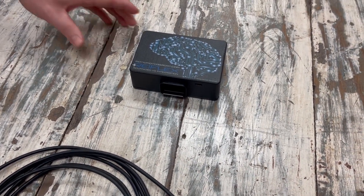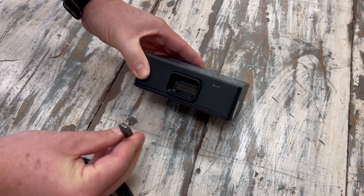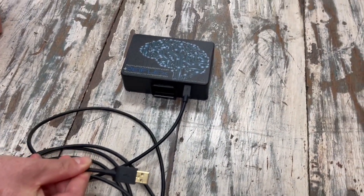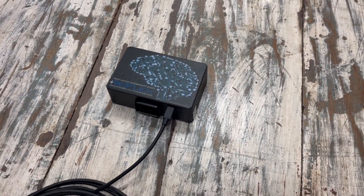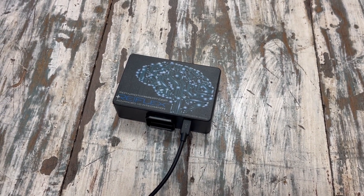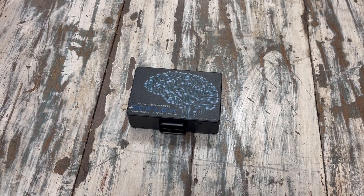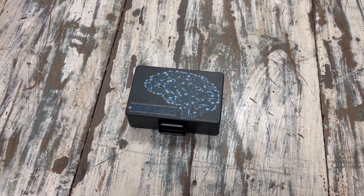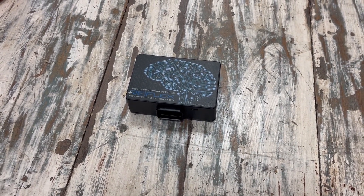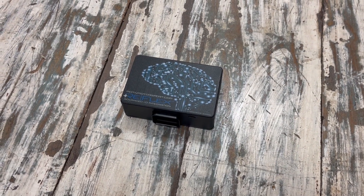The USB port plugs right into the side of the box. Here on the bench you can see it's a standard micro USB — we just plug it right into the box, giving us our connection with a standard USB on the other side ready to plug into the laptop. At this point that finishes our installation of the Motive controller box. We generally don't leave the USB connected — that's something we just use when we're going to write to the box. Once your initial setup and basic calibration is done, you're pretty much set and forget. You normally don't need to connect to it again unless you're doing an injector size change, a large boost change, or some sort of fuel change. Most of your tuning will be done on HP tuners. Thanks for staying with us throughout this Camaro install video — if you have any questions feel free to shoot us an email or give us a call. Stay safe out there.